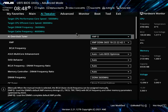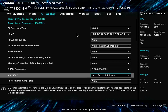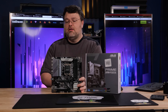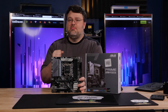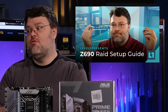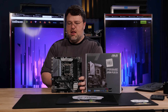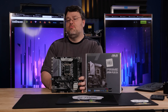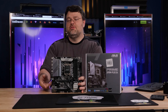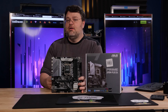In terms of BIOS support and other features, because it is DDR4, the motherboard does advertise support for DDR4 speeds up to 5,333. The fastest memory I have is DDR4-4000 — a Crucial Ballistix kit — and that did work in this motherboard without too many issues. XMP Optimum — that's really good. If you pick this up and want to set up Intel RAID, the VMD devices, be sure to check out our separate video on RAID with the Z690 chipset specifically. It works without any VROC keys, licensing, or any shenanigans. On a platform like this you could run RAID 0 or RAID 1 of M.2, and with three slots you could run RAID 5 — one off the CPU and two off the chipset — and it won't bottleneck.